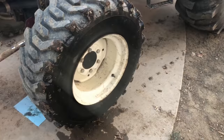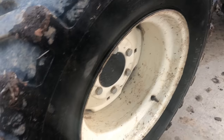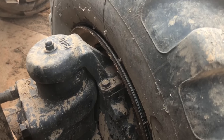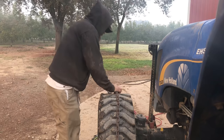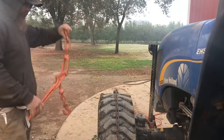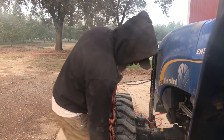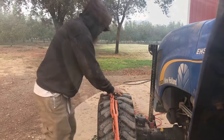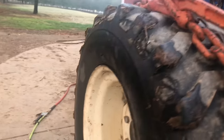Now that we've got the front end jacked up, that rim kind of almost seated itself back on the tire, but there's still a little gap there. So in order to pump it up, there's something we need to do. Once I have the tire off the ground, the next thing I need to do is take a chain and wrap it around the tire. You want the chain pretty tight but not so tight that you can't still hook a binder onto it. Once you have the chain on there, put the binder on. With the binder cinching the chain down, it depresses the center of the tire a little bit, which in turn pushes the sidewall out, so when you put air in the tire it should seat itself to the rim.